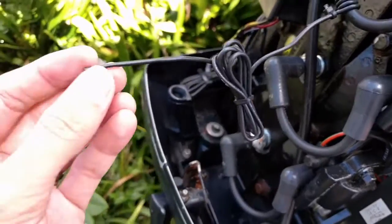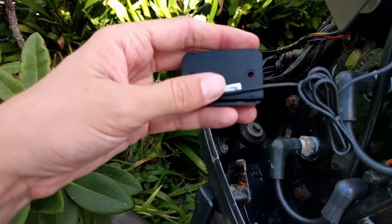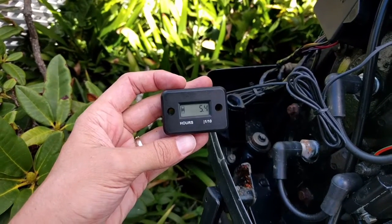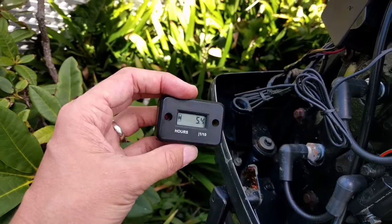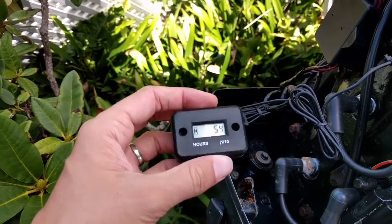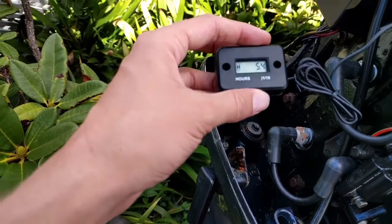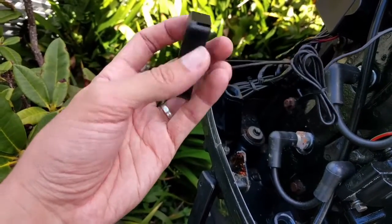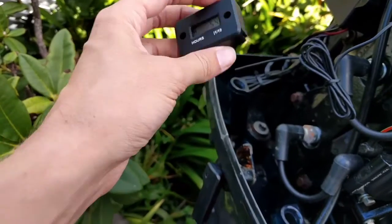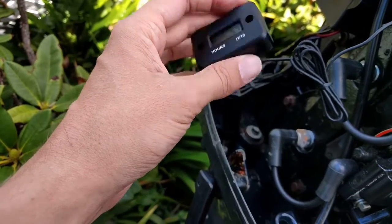You actually run that last piece around until it connects back up so it's all in one hit. I've bundled this up as well and then this is just going to pass through the back of this unit, so it'll wind up being pushed in there. This is completely sealed. I assume it's got a battery in it that says it lasts for a lifetime, whatever that means. Maybe it gets some extra charge from induction from the switch, but certainly it's not having to do too much work other than keep this display lit and then have some sort of timing or counter based on what's firing. It must be an actual timer because it doesn't know how many cylinders, so it doesn't really know how frequently that'll be sparking and the reeds and so forth. Obviously it's working — it's done 5.4 hours so far.